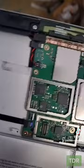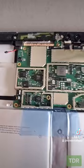Let's replace the Power IC chip and test. Right here, we remove the PMIC and a bunch of capacitors because we noticed there's a short. We're getting zero here as we should, and we have the three volts right now. Nice — we got it.